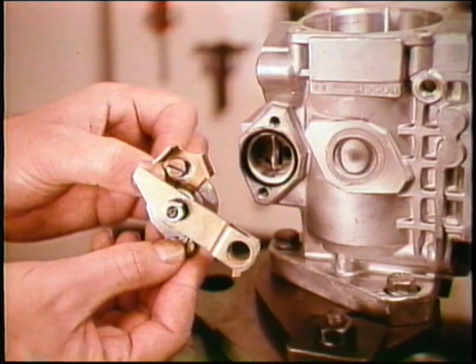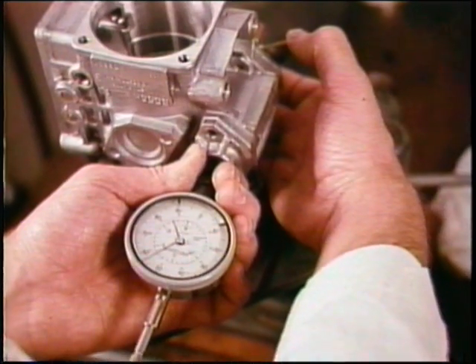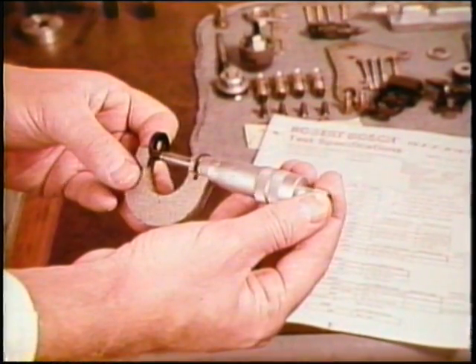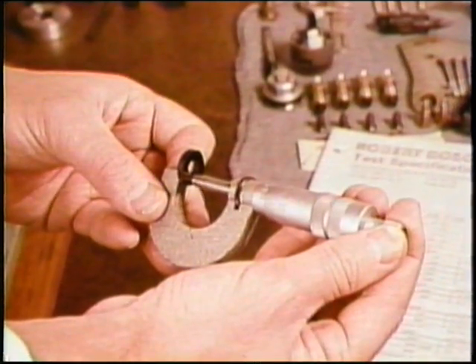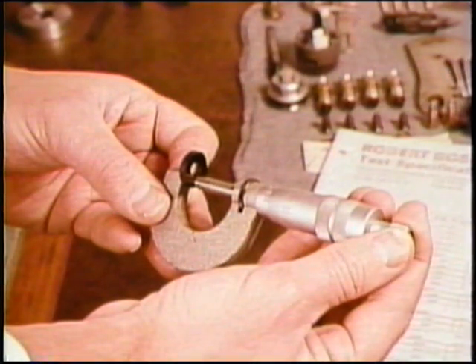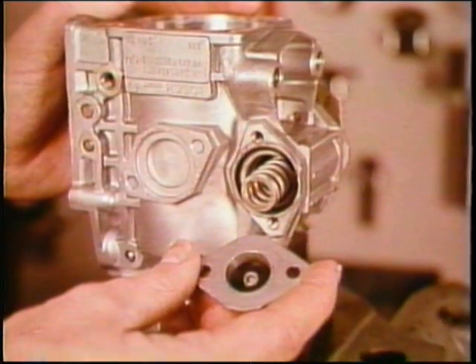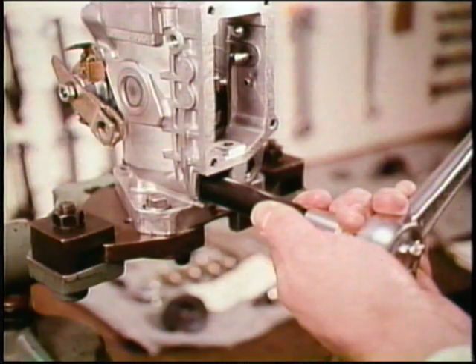Install the O-ring and the cold start advance mechanism. Now some VE pumps may have a cover plate. Check for correct cold start travel as outlined in your written instructions. Next, measure the thickness of all shims removed from the timing piston and cap during disassembly, and compare this value with that shown in the spec sheet and adjust if necessary. Insert the 0.6 millimeter shim into the timing piston. With the remaining shims in the cap, put in the spring and the O-ring and fasten the cap in place. Use the special socket to install the pressure regulator.